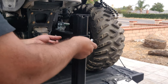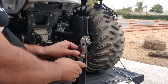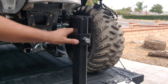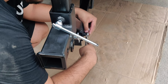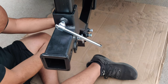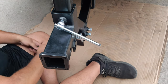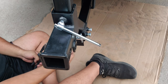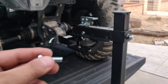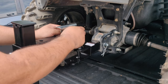You can now proceed to tighten all the hex bolts previously installed — starting with the vertical tube, then tighten the four hex bolts on the housing weldment. The previously removed bolt and nut can be fixed to the ball coupler once again, which will keep the coupler handle from accidentally loosening up.